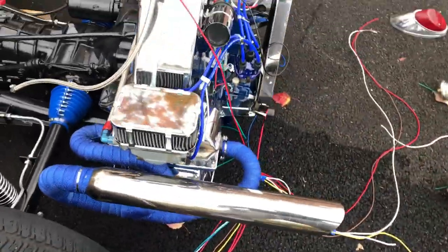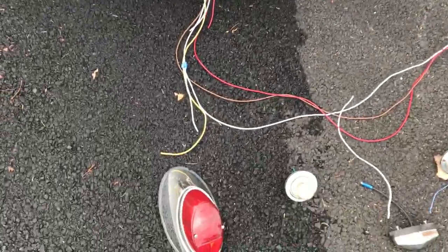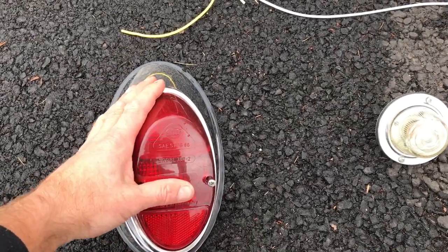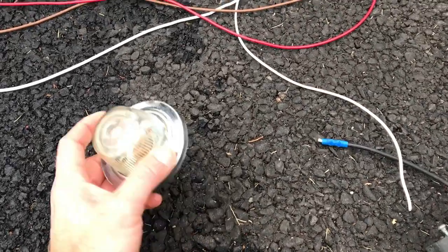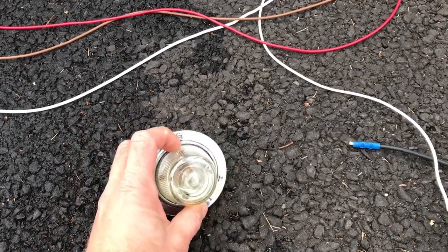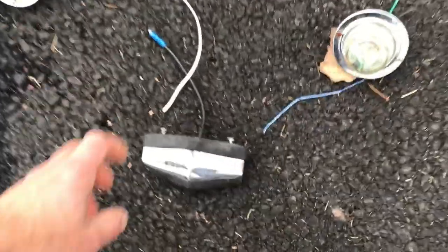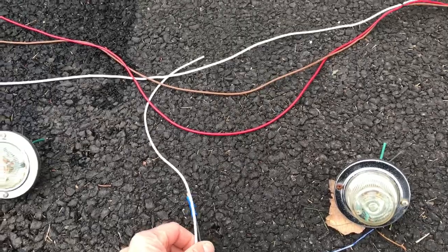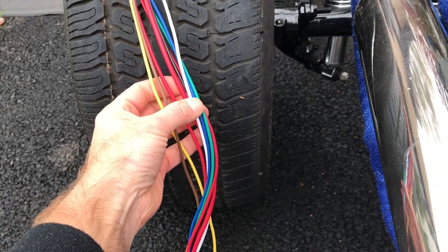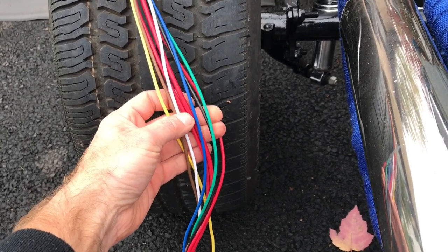To the back. As mentioned before, we've got the brown wire, the yellow wire, the red for the brakes, and white to connect the rear turn signals and brake lights. These are my backup lights, which I will wire up myself as there are no wires that come with the harness — I'll run wires straight to a switch and a power source by the fuse box so I can turn them on and off when backing up. The license plate light will connect to the white wire in the harness and then be grounded. Then we have the brown, white, and red for the right tail light.